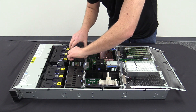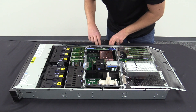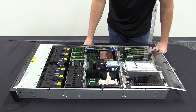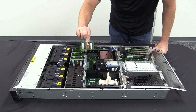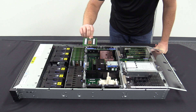One of the interesting aspects of the new Power 10 is the memory DIMMs. This particular frame has multiple memory DIMMs. We actually put in a full terabyte of memory in this particular box, and each of the DIMMs we are using are 64 gig DIMMs. These might not look like a traditional memory DIMM you might see around your house or on a different computer. IBM makes these themselves.